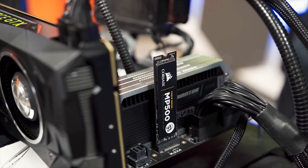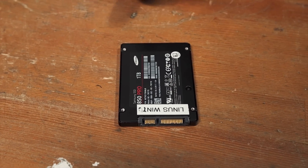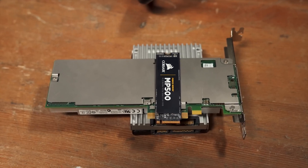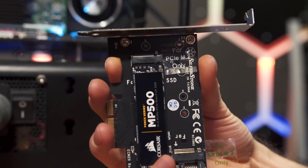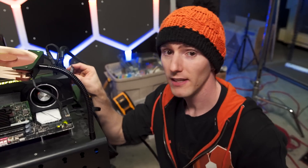Thanks to its performance, M.2 also uses a maximum of four PCIe lanes, as well as its compact form factor that allows it to be used not just for desktops but also for ultra-thin notebooks. But getting back to the whole lesson on protocol versus physical standards, most of these physical connections support multiple protocols — more than one way for the computer to communicate with the drive's controller over the physical wires. And if you aren't using an NVMe protocol drive in your M.2 slot, you might not be getting the full experience. So if your computer has a PCIe M.2 slot — and you can see the difference here between an NVMe-capable one and an AHCI-only one, they're usually labeled — then it's simple: you just plug it in, maybe configure a couple of settings in the BIOS, and you're off to the races.